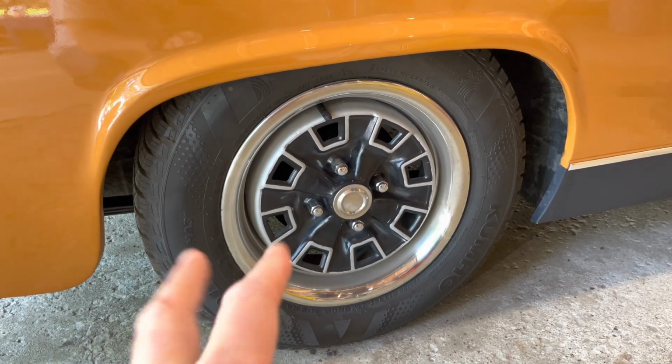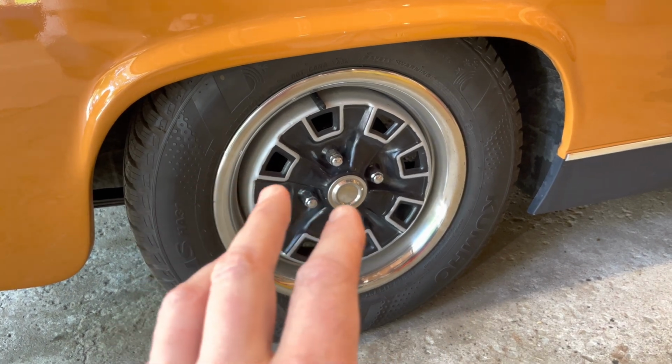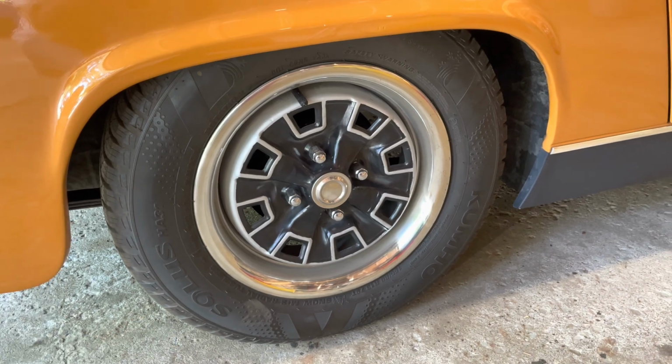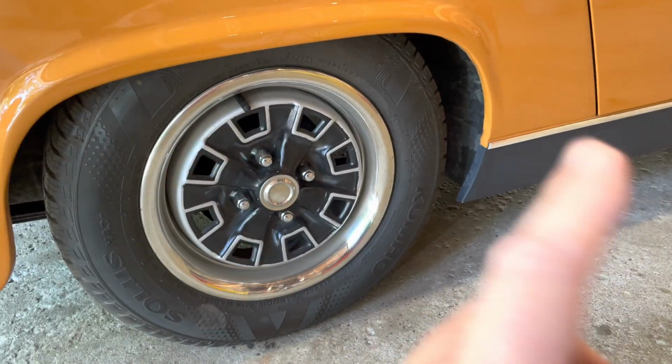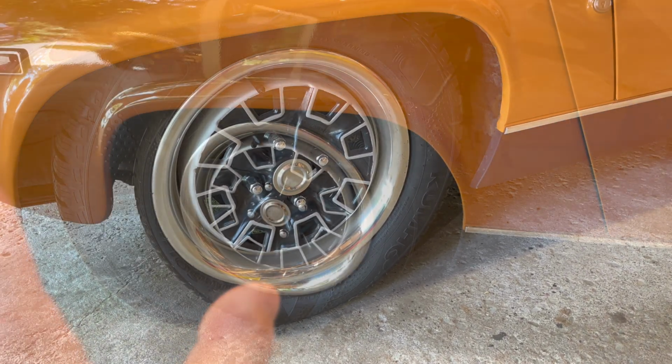I can't remember which one is closest to the tank, but I'm going to pull them out, replace those two fuel filters, blow some air into the tube that goes into the tank, and then put in a new fuel filter, and see if that solves my issue, which hopefully is just fuel.